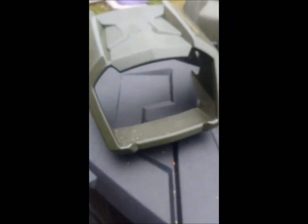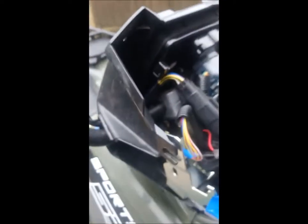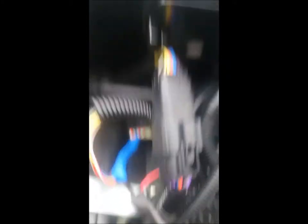Moving on to the bike, you need to take off the front shrouding surrounding the big spotlight on the front and also remove the headlight itself, which simply comes off with those two bands there, which I've taped up just to keep them safe. There is also the adjusting screw for the headlight. The wiring loom itself looks a bit daunting — it's covered in this plastic-type material. All you need to do is remove that. Don't cut it off; it actually comes off with a natural cut in it. What you're looking to do is remove it around the back of the ignition key.